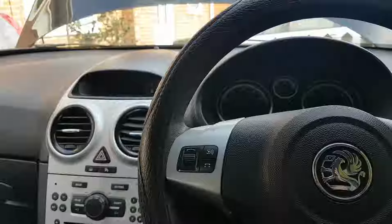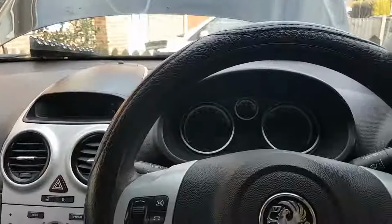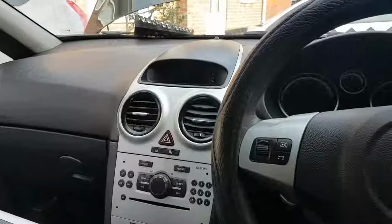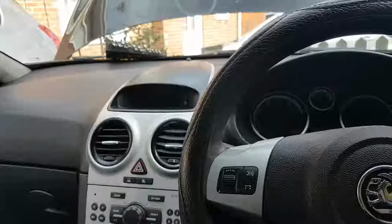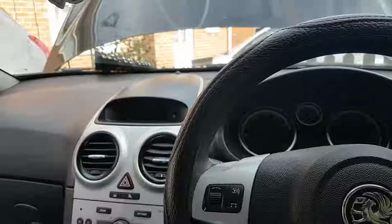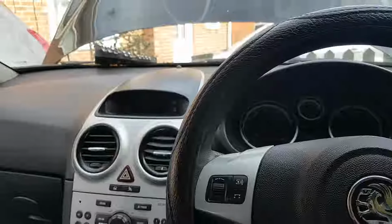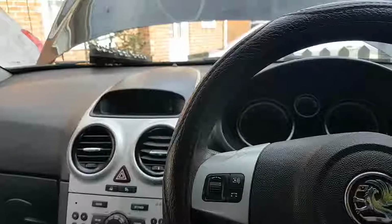Now the challenge, let's go. Okay, and the battery is now on charge. The ground is back on ECU, and they completely ripped the threads on the actual ECU, where the bolt for the ground goes. So that's completely cross-threaded. The bolt doesn't really hold that well now, so we're gonna have probably to rethread that and put a slightly bigger bolt.